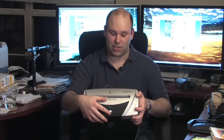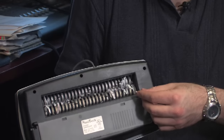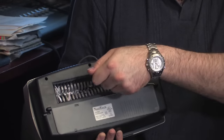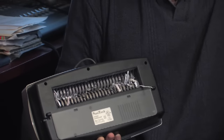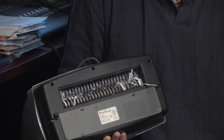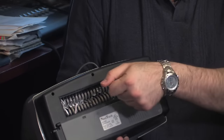What happens if reverse doesn't clear it? This is where things get a little more interesting. Look at the rollers — as we can see, this shredder has been used recently. See if there's a big hunk of paper and try pulling it out very gently. You can pull slowly and it won't damage the motor. Don't yank it, because you could damage the motors and, more importantly, leave a stuck piece that you can't grab easily — you'd just rip off the part that was easy to grab.